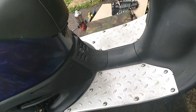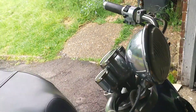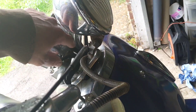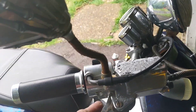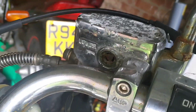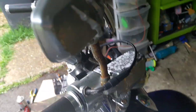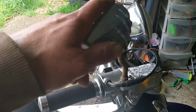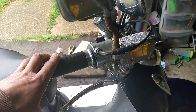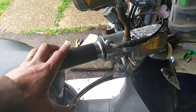I'll do what I can. A few other bits need doing — the indicators are all a little bit ropey, and one of the lenses has fallen out on the other side, so I'll have a look at those. It would make sense to do a clean up and tidy up first, but at the moment I really have no front brake because this is so shagged and there's no fluid left in it anyway. So what I want to do is change the levers out first because I want to give it a test ride, and I'm not brave or stupid enough to do that with only one brake.